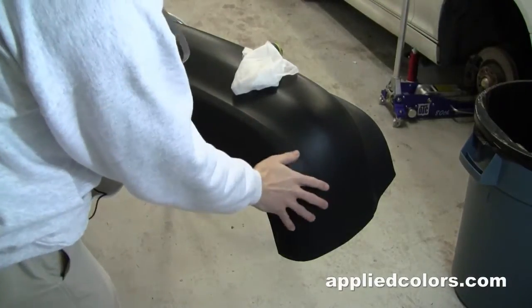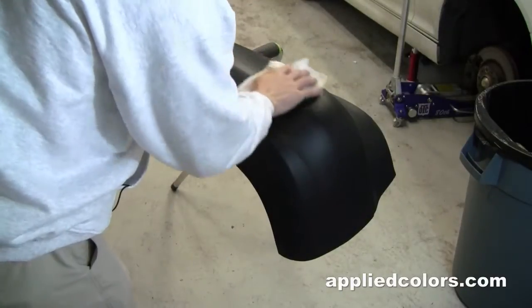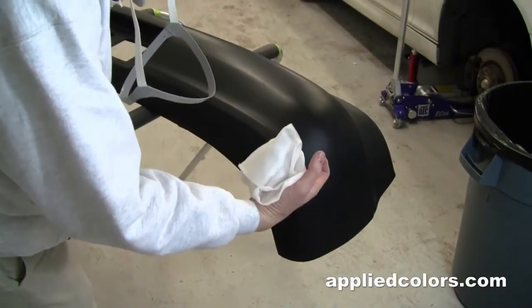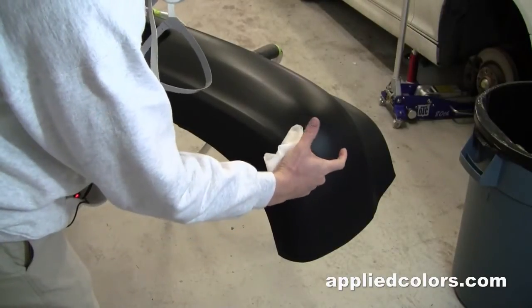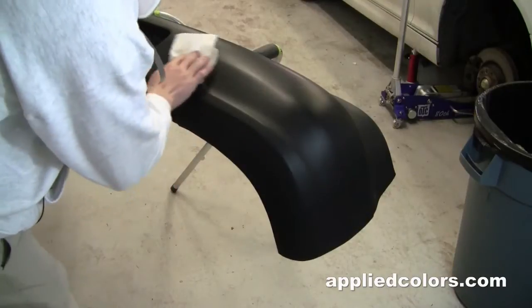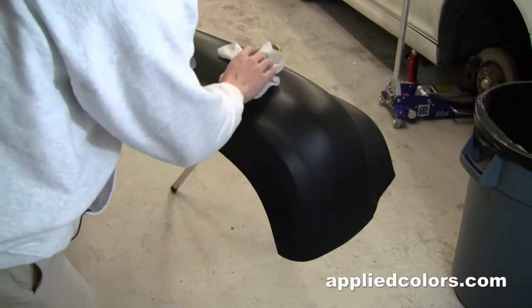Before I spray the base coat on the bumper, I like to get out a tack rag and just make sure that we're lint free. And I'll also use the air feature on the trigger, so I'll just give it about 1/8 pull to get some air to move the dust around, or at least blast the dust off of this area that I'm painting.